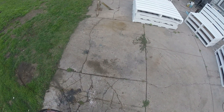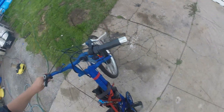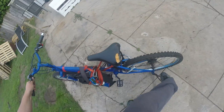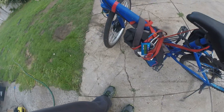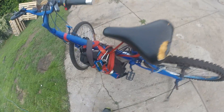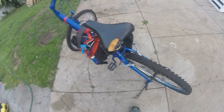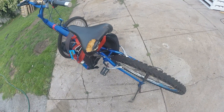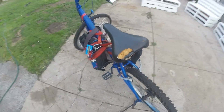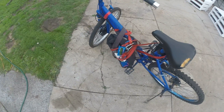Need to get a tripod that's easier to extend. The battery bag's falling over on us, of course. I'm going to actually mount a toolbox here, put a couple of brackets up, and mount a toolbox over the back wheel to carry the battery. The motor speed control can go back up in the frame, further up, closer to the motor.